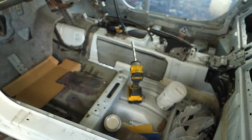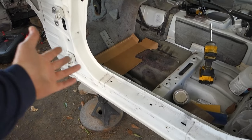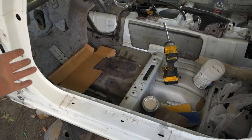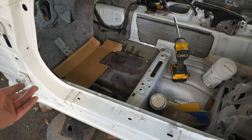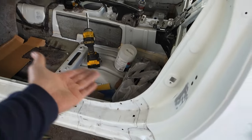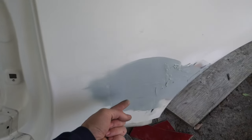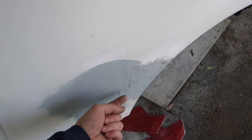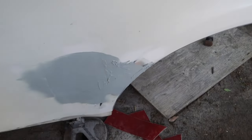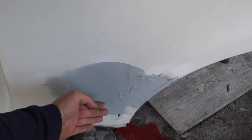This is the damage from the drift event where I was having an issue with the handbrake — the rear brakes were dragging and locking up. I straightened up and it put me into the barrier, which hit the door and put that big crease in it. I actually picked up another door to replace it. Then it spun around and just barely grazed right here over that little lip and put a big crease in it. So I'm working on getting that taken care of.